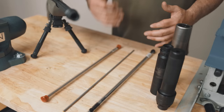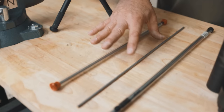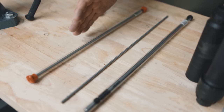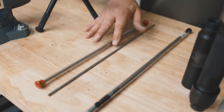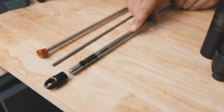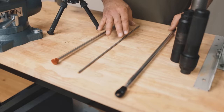There are a lot of great alignment rods out there — I just grabbed a few. We have a toolbox around the corner with a drawer full of them. This is a Geissele rod — great rod. This particular one is a piece of precision ground steel that we cut. Every once in a while, roll it on a granite countertop just to make sure it's dead straight and hasn't been bent. This is an Accuracy Solutions rod — we use a lot of those. Buy a quality rod and check to make sure it's straight.